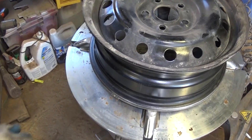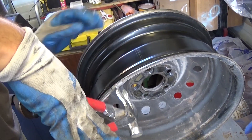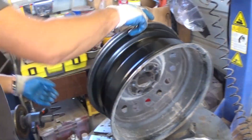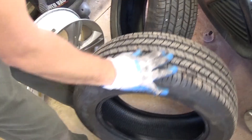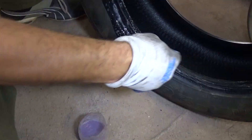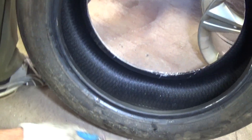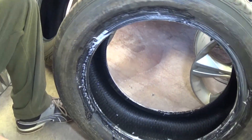It's the time to remove all the weights and stuff like that from the wheel. We got that done. These are the tires we'll be installing — brand new tires practically; we had them on another car but they have less than a thousand miles on them. For lubrication, you can get tire lubricant, or what we do is a little bit of detergent mixed with water — it lubricates really well. Make sure there is no dry spot at all; it needs to be lubricated really good, otherwise you risk breaking the bead.